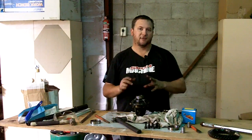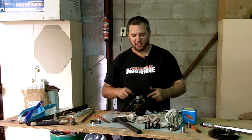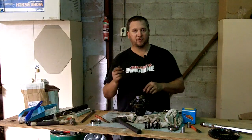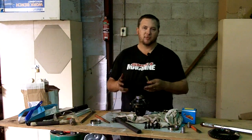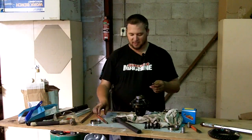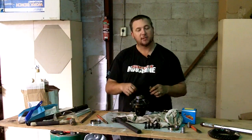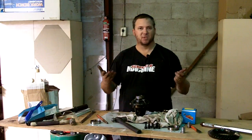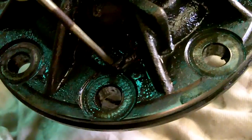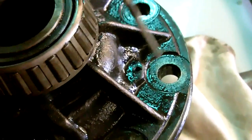We're about to split this center. Now, this is a four pinion center, but it actually only has three pinion pins — one long pin that runs right through the center and two short ones. They're all held in place by these little roll pins which you have to push out. You really need a good range of pins and punches to do one of these. I've got a heavy punch and I've made up a light punch with an old screwdriver — turned it into a pin punch and it works perfectly. There's the roll pins I was talking about; I've already knocked out one of them.